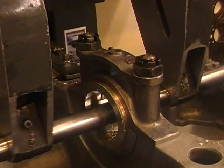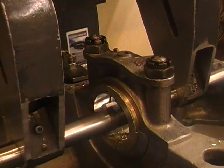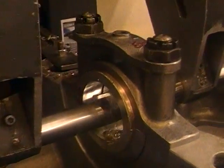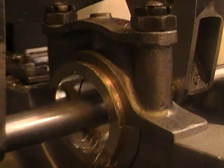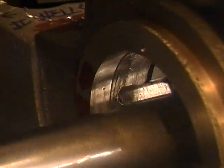When the final cuts start we'll be taking much much smaller cuts, looking for an overall diameter that's about two and a half thousandths larger than the crankshaft itself. You can see the chip coming out. If you look in the back you'll see both the groove and the reservoir for oil that were cut earlier. Those were actually cut up on a lathe, so they're not being done as part of this process. They were cut deep and the depth is calculated based on what our final finish would be of the bearing.